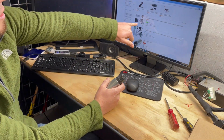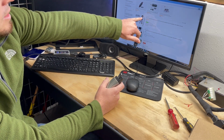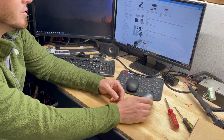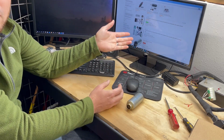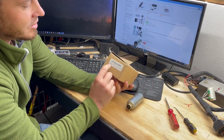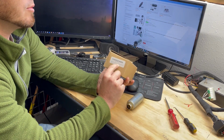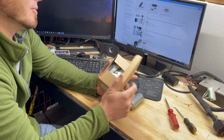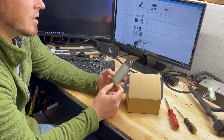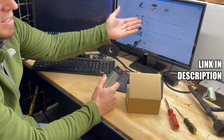When we looked, we actually found a complete knockoff pump set that has the connector, the filter sock, the rubber dampener isolator, the discharge hose, all sorts of things that we would need to run our old pump. So it's like, well, hey, no brainer, let's buy a complete pump. All right, so this is what we did. And as you can see, when it arrived, it says 255 liter per hour, high performance electric replacement for Walbro GSS 340. So a normal Walbro is like $70 to $80 just the pump itself, maybe $130 for the whole kit, as you see here. So $130 versus $18.